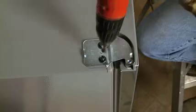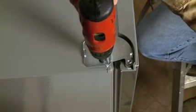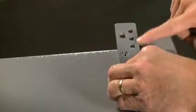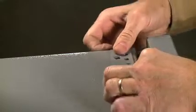We will now look at a single unit installation. From the unit's top hinge, use a 3/8" socket to remove the outer screw. Set the screw aside for later use. Next, using one screw and the 3/8" socket, install the mounting bracket.